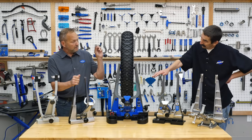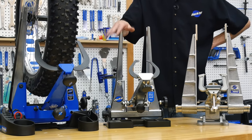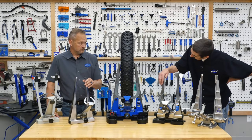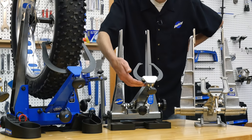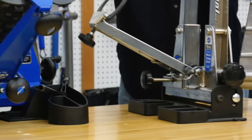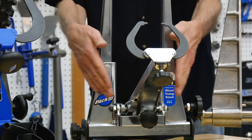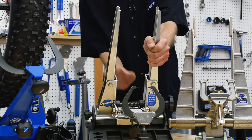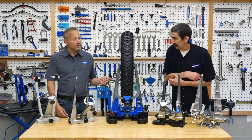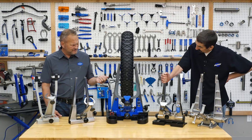The TS-2 has more adjustments than the TS-1 — this is the model I cut my teeth on as a young mechanic truing wheel after wheel on all those Schwinn assemblies. The main caliper arm comes down and is welded to the center bracket. Because of this system we can shove it left to right and adjust it nicely. We also have collars that let the two upright arms move independently of the center caliper arm — a lot more adjustability. The TS-2 was made from 1973 up until about 2010.